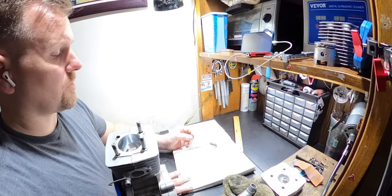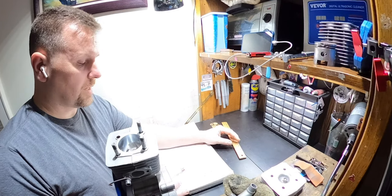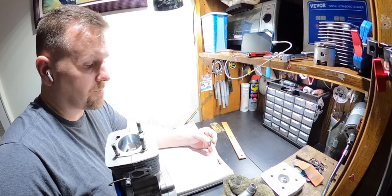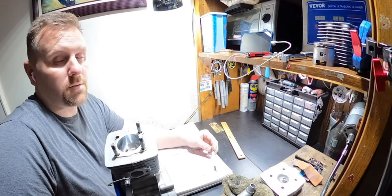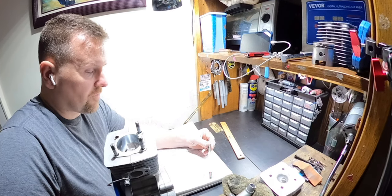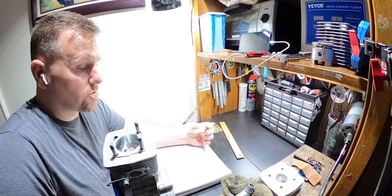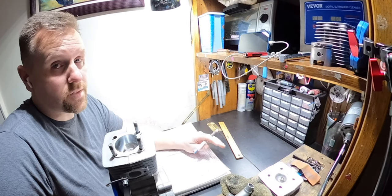As a whole, guys, this is a motor that started with a 2 millimeter squish gap and numbers that, let's just face it, are just dog numbers. It's going to run. You could pretty much make this thing a pinhole and it's going to run, but without proper flow, you're not going to get any performance. You're definitely not going to get a larger person up a hill pulling a trailer with 100 pounds in it. It's just not going to happen.